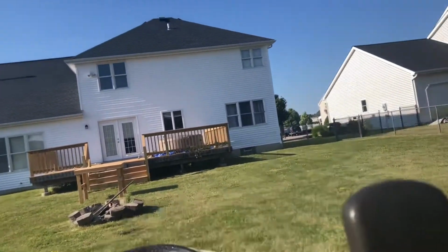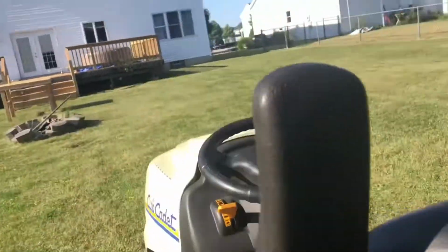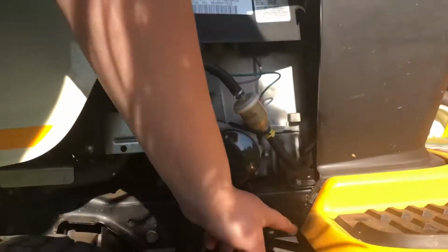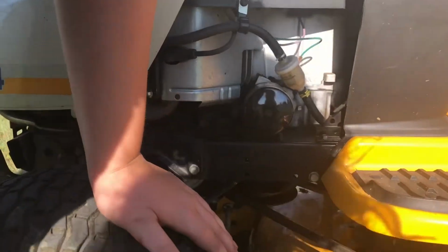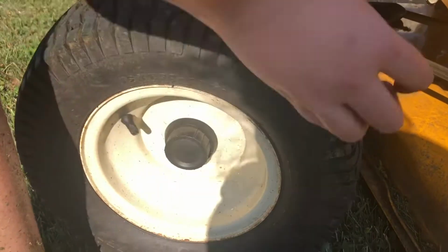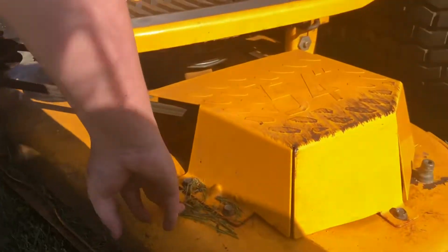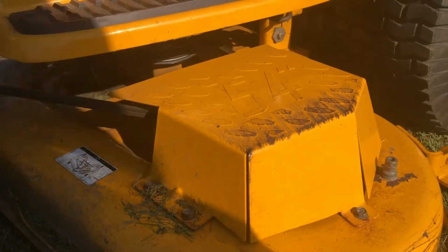It seems here, this was made in 2006, this model. So this is a 2006 model, that is a 2007. So this is a year older. And as you can see, the frame is a 12 gauge steel frame that has things bolted to it instead of them being welded. That is one difference. They used ball bearings in the wheels, a cast iron front axle, and they used these heavy mower decks made out of, I'm pretty sure, all 12 gauge steel. These 54s on these GT1554s had a striping kit on the back to help you stripe your grass.